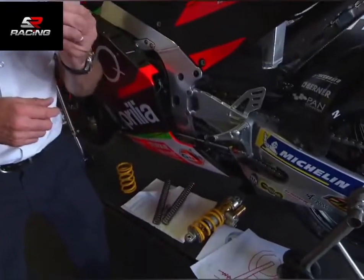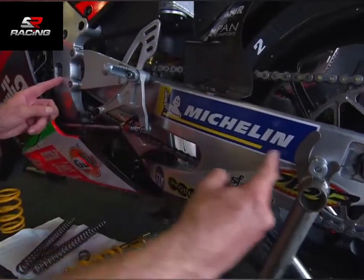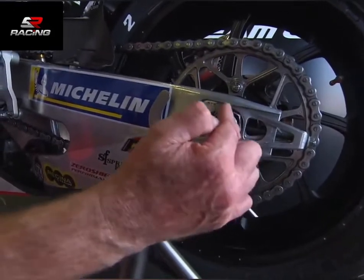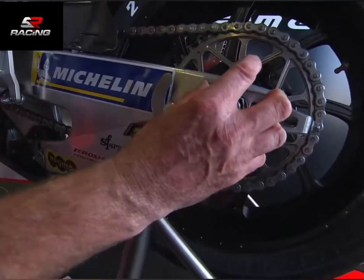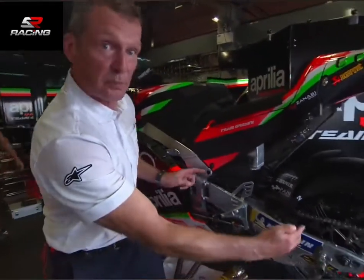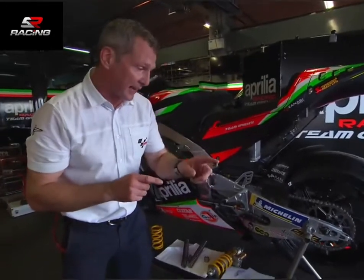The wild card with the rear of the bike — there are two wild cards. First: the length of the swing arm. Imagine you need to change the gearing and you're going to change the rear sprocket for a bigger one to lower the gearing. If you do that, to get that bigger sprocket in, the axle needs to come forward. If we put a smaller one in, the axle needs to come back. The problem is the length of that swing arm affects the amount of leverage. If you go shorter, the spring's going to feel harder. If you go longer, the spring will feel softer because there's more leverage. The engineers know how to calculate that in and keep the rider happy, whether it's with a small spring rate change or preload.